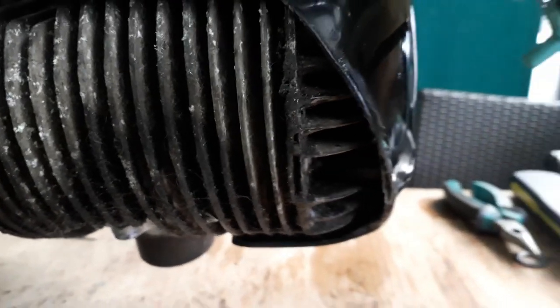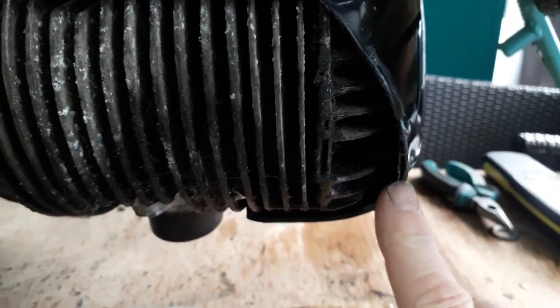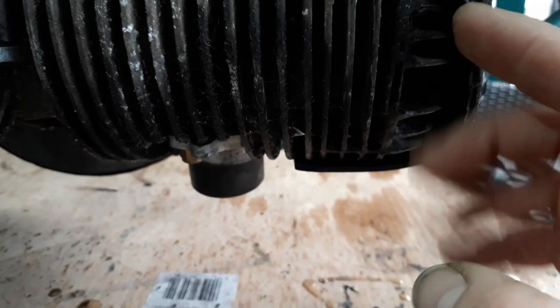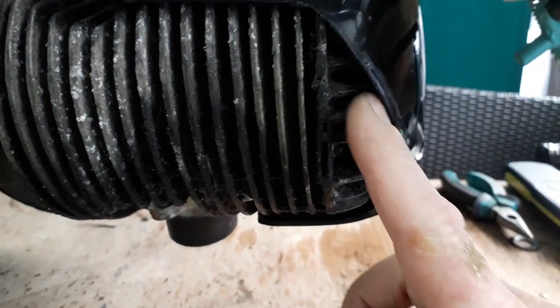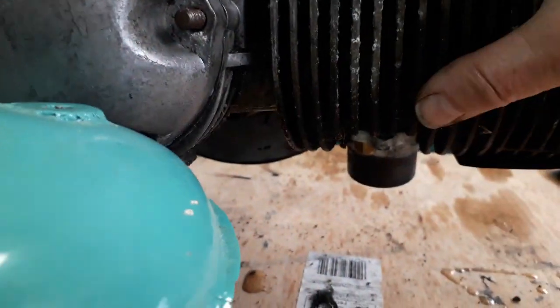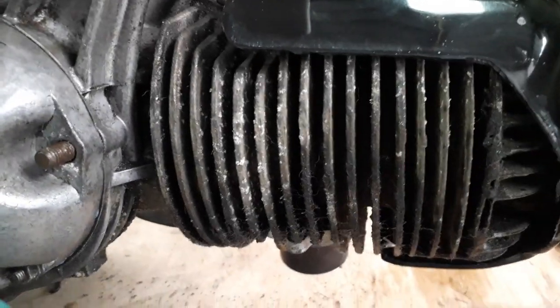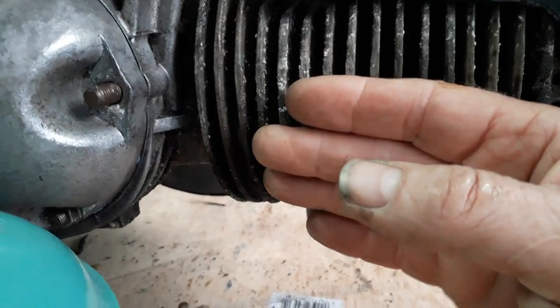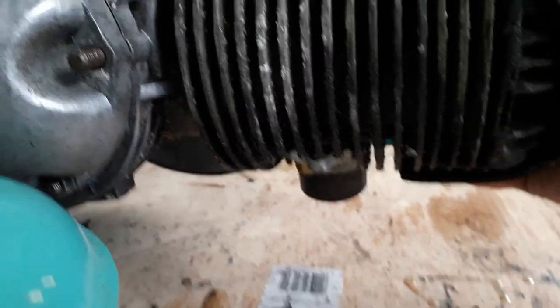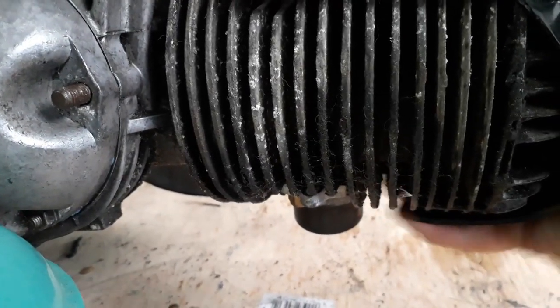On the other side I've also changed the cylinder head cover. As you can see with my fiberglass cover, I've actually cut away here on the fiberglass to allow the flow over the top part of the fins. So now you've got air that's being forced around — it's actually passing over the top of the head instead of being blocked. This is completely open to allow the maximum airflow through. You don't need to cover this at all. You need to have a big area over here for the air to escape, because we're going to be pumping a lot of airflow over this cylinder.